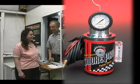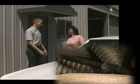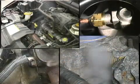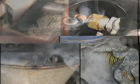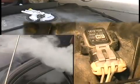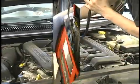The Smoke Pro can easily find leaks resulting in big tickets for your shop, and commonly finds damaged or disconnected vacuum lines, leaking gaskets and fittings, cracked or broken plastic components, leaking diaphragms and seats, worn throttle shafts, leaking or cracked exhaust or intake manifolds, especially plastic intake manifolds, engine blocks, catalytic converters, underdash climate control and central locking system leaks, idle motors and solenoids, brake boosters, charcoal canisters, intercoolers and turbochargers, wind and water leaks around doors, windows and sunroofs, and leaky headlamp and tail lamp housings. Lean codes, drivability issues, evap codes, and many other repair opportunities can now be fixed in a fraction of the time it took before.